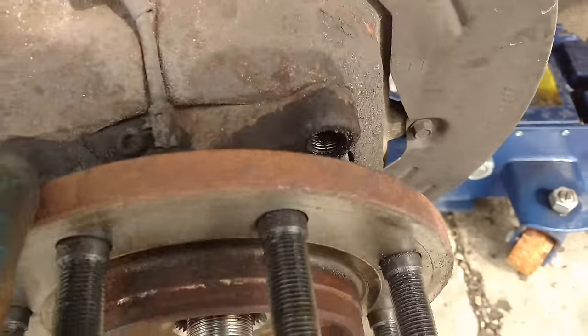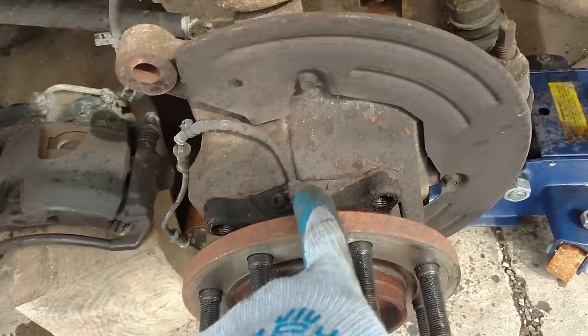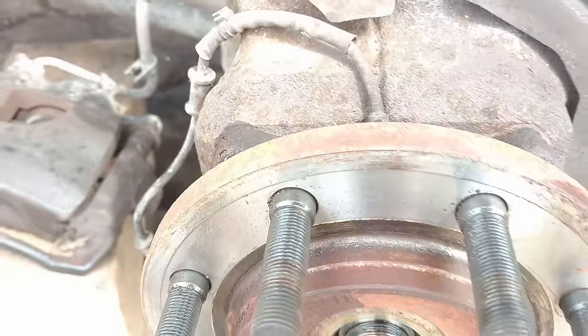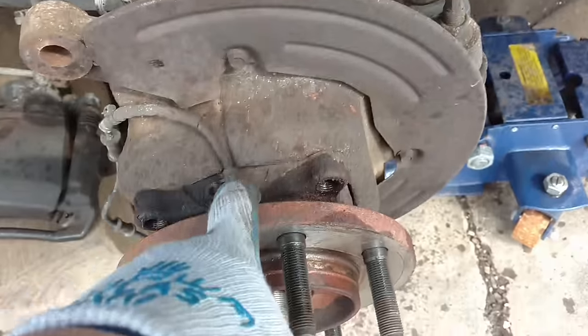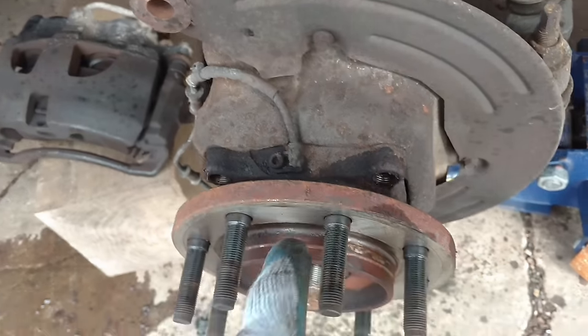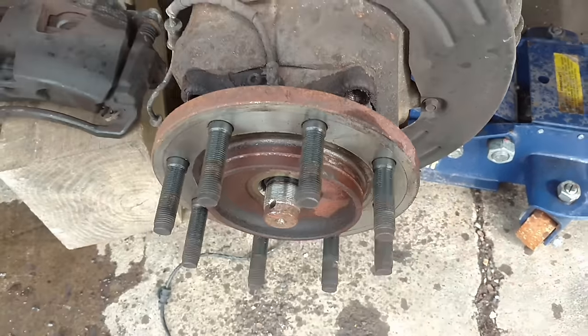Normally I'd be very careful with this bearing, but now I'm going to replace it. Let's see if you can hear the noise — you really can't hear it; it's more pronounced with a wheel on it. So I'm going to take a hammer and tap the back side of this bearing on either side to break it loose. If you were going to reuse it you certainly wouldn't want to do that. This is going to be a little tough to get out — it's pretty rusty. Let's see how it goes.